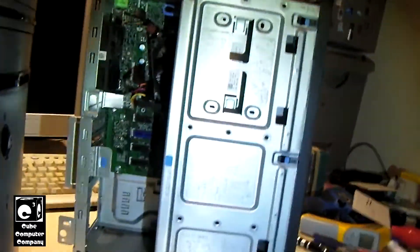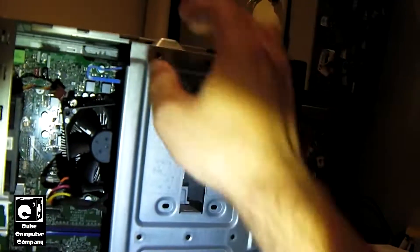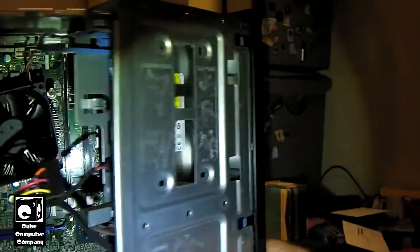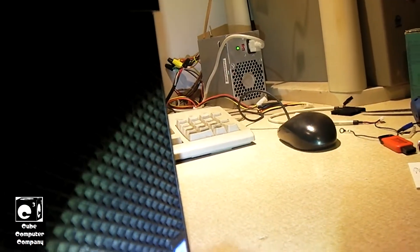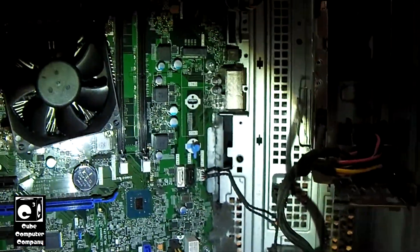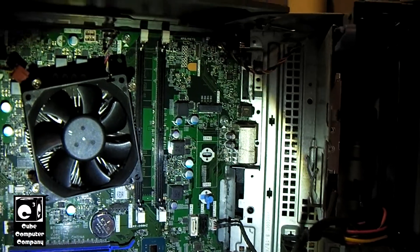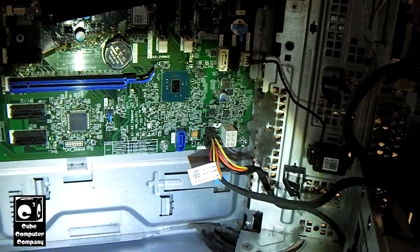Now let's talk about this computer over here. This is a computer that was basically written off as scrap — that's how I ended up with it. I got this from a friend of mine who got me the OptiPlex 390s. This is a Dell OptiPlex 3050 — it's relatively recent, a 7th Gen Intel i5. And you can see that is not a standard motherboard — that is a proprietary Dell motherboard. It uses a proprietary power supply unit. You can't just go to Best Buy or Newegg and get a replacement supply. Newegg may carry replacements, but they were specifically designed for this machine.